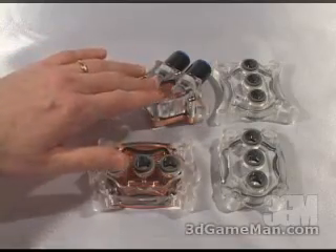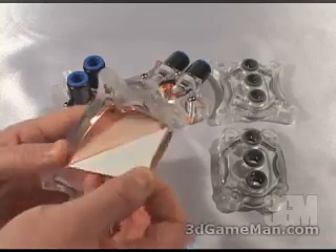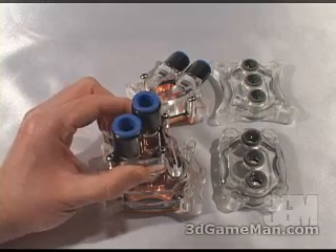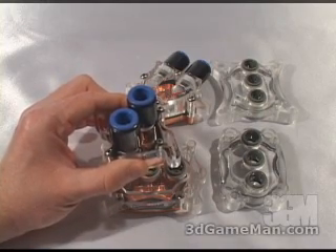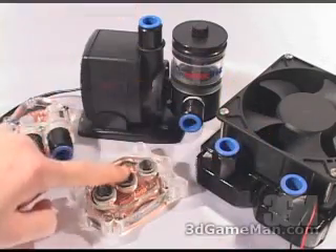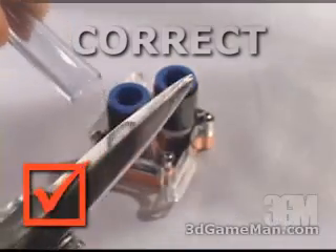The chipset, GPU, and CPU water blocks all have an acrylic top and a thick smooth solid copper base, as well as quick connect fittings. They are very easy but secure to install tubes into, and all components in the system have these quick connect fittings. Make sure the tube is cut fair, push it all the way in, and it's installed.